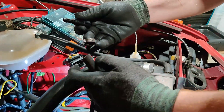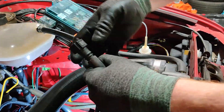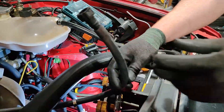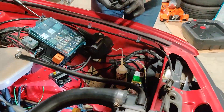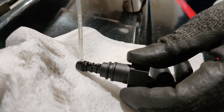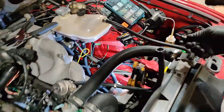The bigger the push lock, in my experience, the harder they are to get the fittings in. A little lubrication makes it a lot easier and keeps it from tearing the O-ring on the end of the fitting. Same goes for both sides of the return fuel line — just a reminder, this is on the return going back. You can plumb these in-line on the pressurized side of the fuel system, however I find it easier to go on the return since there's lower pressure and less risk of fittings leaking or causing a flow disruption.